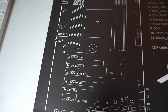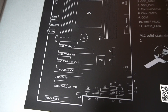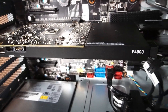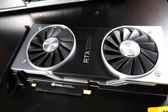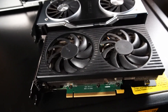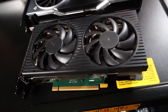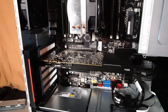There's a generous amount of expansion slots for PCIe lanes, the main one being the PCIe 3.0 slot the graphics card is currently in. You could install an RTX 2080 since 20-series NVIDIA cards are PCIe 3.0, and you can also fit something like an RTX 3060 Ti with PCIe 4.0 speeds — you just want to think about what's appropriate for the system.